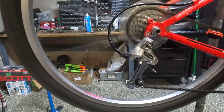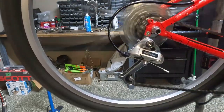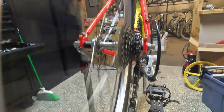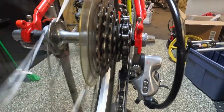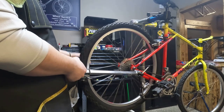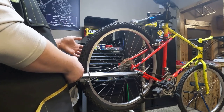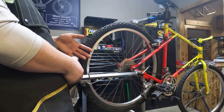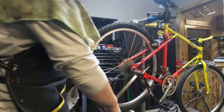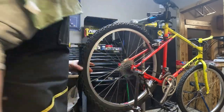Now let's adjust this derailleur. I'm gonna bet that the derailleur hanger may be bent - oh yeah, the hanger is bent. We put on our derailleur alignment tool. You always measure to the same part of the wheel every time - the easiest part is obviously the valve stem. We did just true this wheel, but if you're ever adjusting the hanger on a bike you haven't trued, it's important to always go from the same spot. It's bent up and down quite severely.